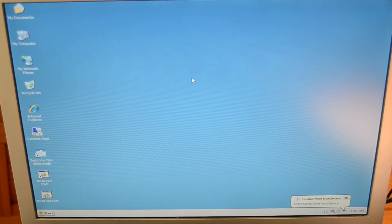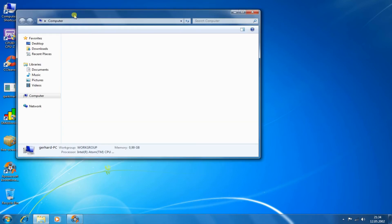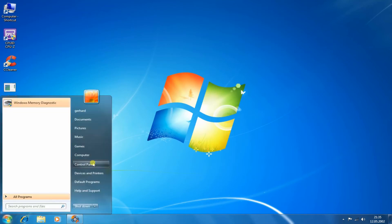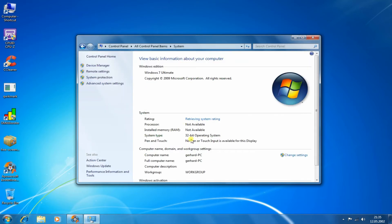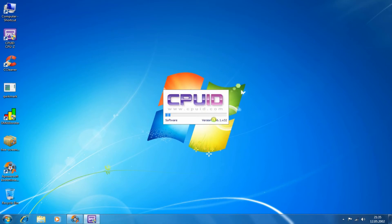I'll make a cut and install Windows 7 to do all the tests on it. After installing Windows 7, going to Computer we can see that from the 8 gigabyte SSD only 250 megabytes of free space remain — this is really nothing. You should definitely go with the better model with a bigger SSD or install a slim version of Windows 7. Under System, it shows a 32-bit CPU, the Intel Atom N270 running at 1.6 GHz with 1 gigabyte of RAM.